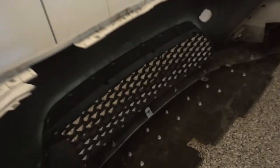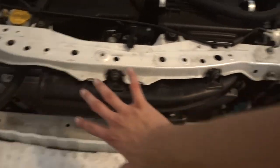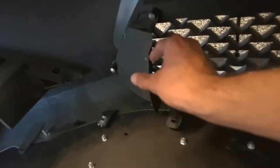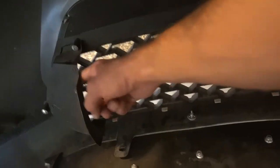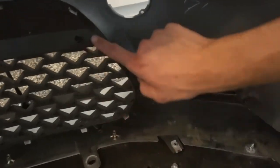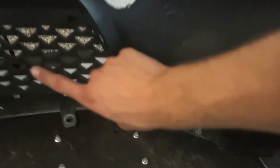For those who stayed to the end there's a little bonus. The oil cooler is placed in a somewhat awkward spot along the front of the car — air flows in through the grille and hits roughly the center area, but the oil cooler is all the way over on the left side. I had a fear it wouldn't get enough air, so I did two things. First, there's a piece of ducting that ducts air from the side in toward the radiator. I took that off this side because we want the air to shoot toward the oil cooler instead. Removing those three screws means more air is now directed toward the oil cooler.